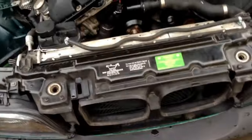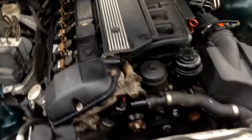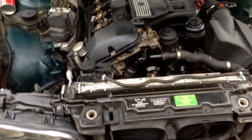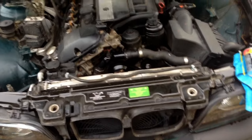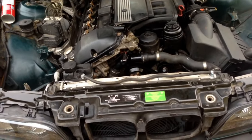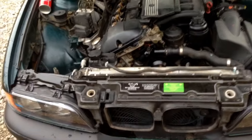Your electric fan — this is your auxiliary fan, you can see right here in the front. This fan has three different functions. The first function: when you turn the AC on, it'll actually turn the fan on. If you turn your AC compressor button on and the fan is not coming on, something's wrong. The second and third functions are for overheating mode. It runs off a sensor which is in the lower radiator hose — very older cars will have it in the side of the radiator. That little sensor controls the fan. So there are two different basically steps: your AC function and your overheating function. Your overheating function has two different speeds — the first speed is low, the second is high.